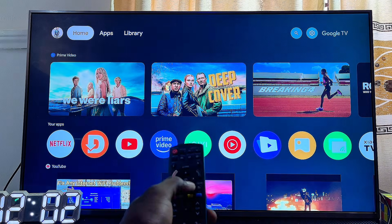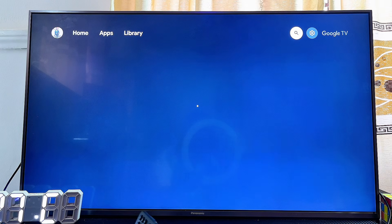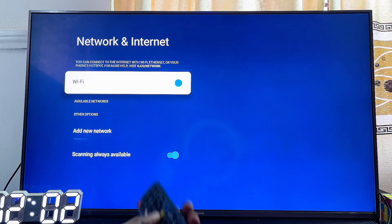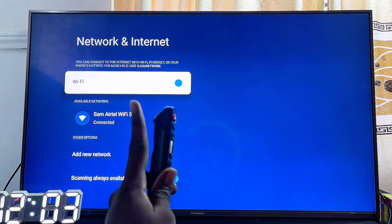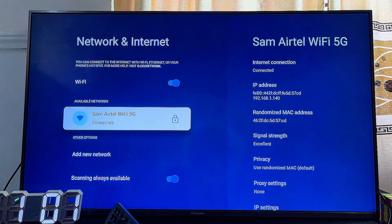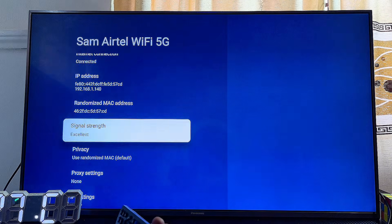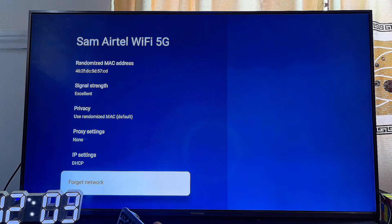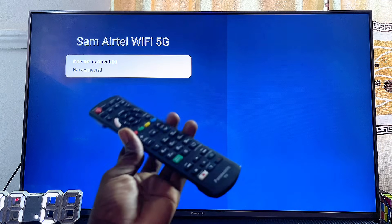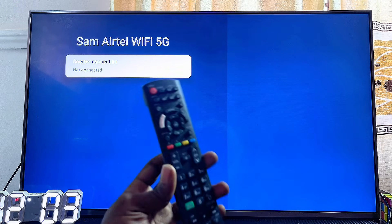Head over to the Wi-Fi settings of your Panasonic TV. Using your remote control, navigate to the Wi-Fi settings at the top of the TV. Open up Wi-Fi, make sure Wi-Fi is turned on, then select the name of your Wi-Fi network. Scroll down until you get to the 'Forget Wi-Fi Network' option and select it, then click OK. This will forget and restart your Wi-Fi settings for that particular Wi-Fi or hotspot.